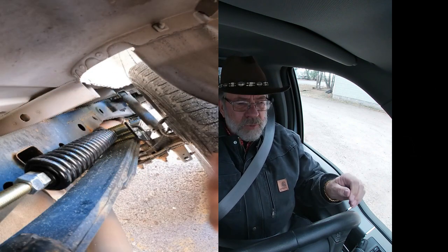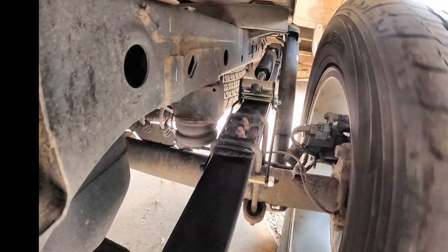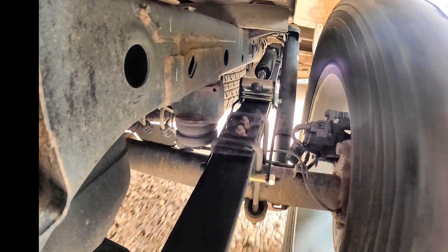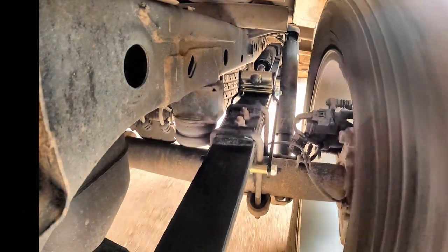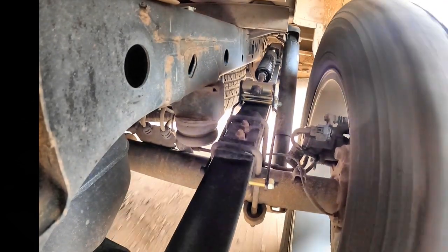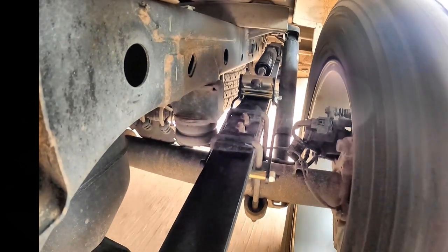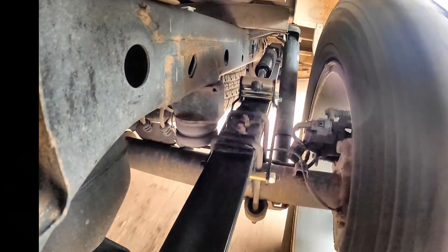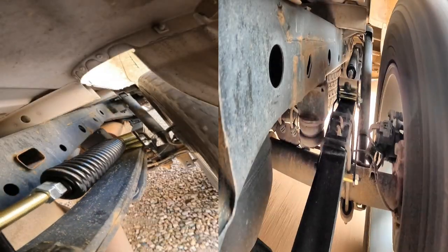Here we are finishing the test on Roadmaster versus Sumo Springs. I'm at 8,000 pounds with my tilt trailer and my Jeep YJ. 8,000 pounds is probably an average load — I haul 12,000 occasionally and a lot of 10,000-pound ones, but I haul probably more 8,000-pound loads, which is really typical of a half-ton. I've got the heavy-duty Roadmaster Springs — I think the heaviest ones you can get for a half-ton. Part number is 3611-YHD.